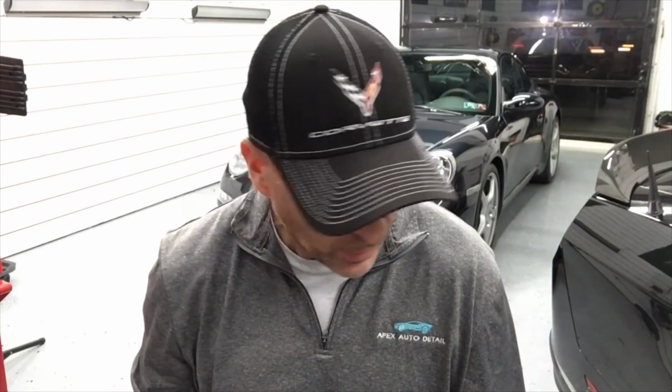Kyle Cartier is working on a car, and near the bottom of the vehicle, there's a lot of tiny rock chips, almost like it's been sandblasted. They're not all the way through, just it's a nuisance if you get down there and look. There are 2 things that I recommend that I know you can do easily. One is wet sand. Just go over it lightly with 3000 grit, polish it out, and see if that improves it.